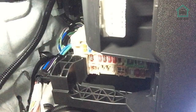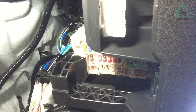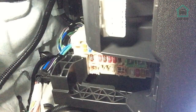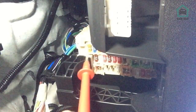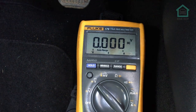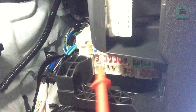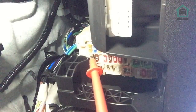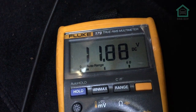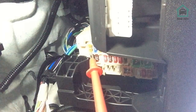I've got my multimeter set up and I've found a sufficient earth for probing. I'm going to start testing fuses one by one, starting at the very bottom. With the key off, that's zero volts. Turning the key to ignition on without starting the engine and probing that - that's 12.06 volts. So that is an accessory live through the ignition switch. I'm going to use that fuse.